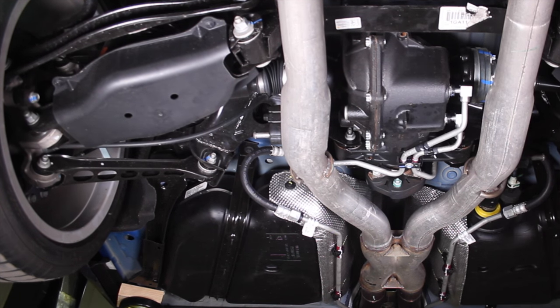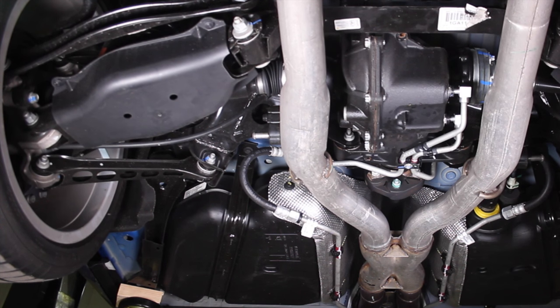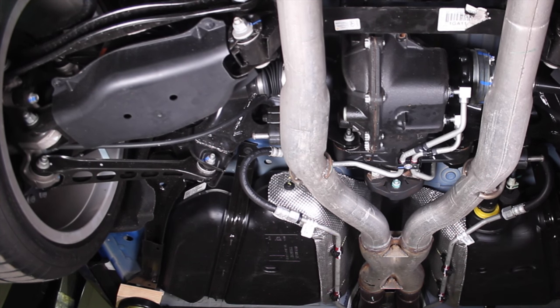They never mix — it's just an in-tank liquid-to-liquid cooler, like you would see with an oil cooler on the side of an engine block. I believe some of the previous generation Camaros, the ZL1 and the Z28, had a similar system, and they integrated that into the new SS in both automatic and manual models.